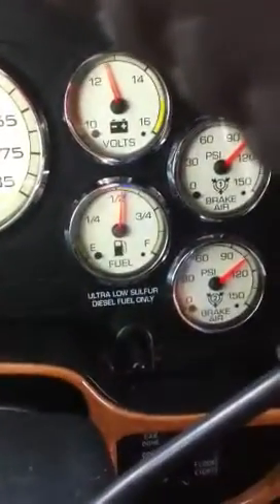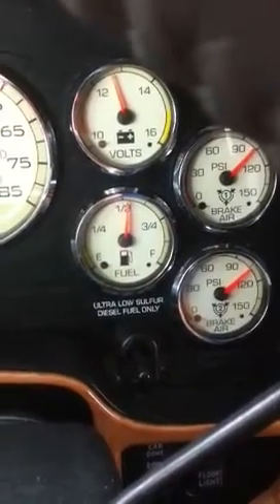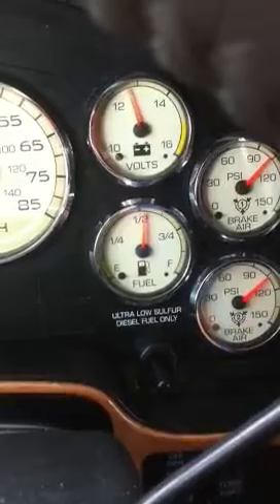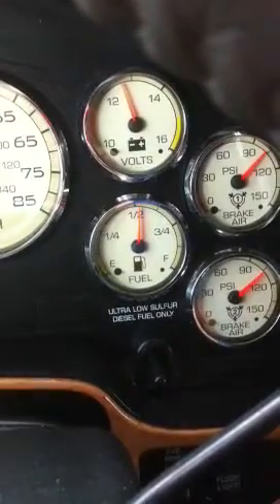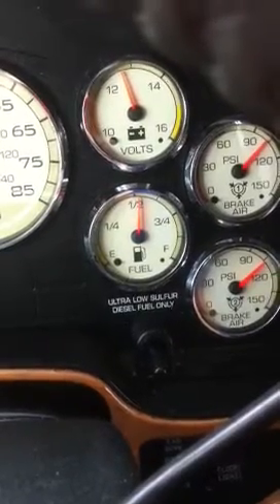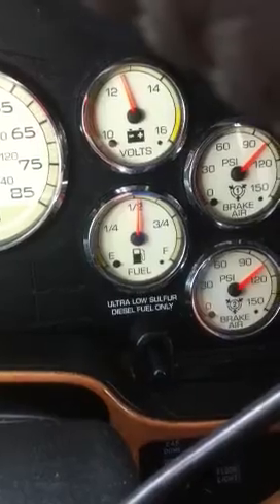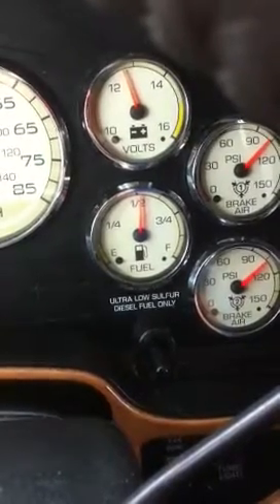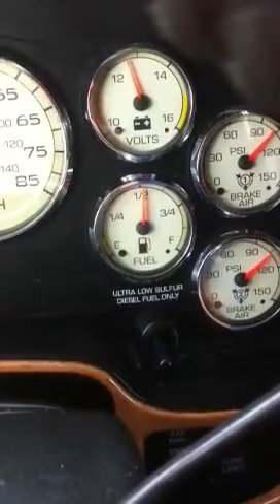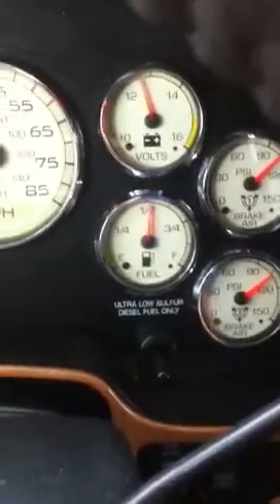Here's the fuel gauge on the truck and you can see it's at half a tank. I'm at the receiver, just got unloaded, and I have a half a tank of fuel. Now on the next pickup, if I was over 200 pounds on my steers and I had a full tank, that's 700 pounds I could have applied to the weight on the steers — that would balance me out with a half tank as opposed to a full tank. But that's for a more advanced video in the coming attractions.